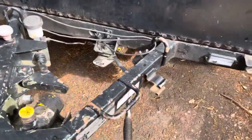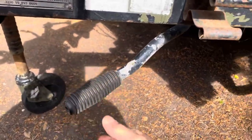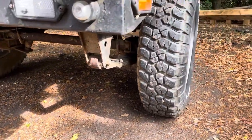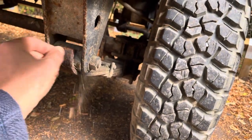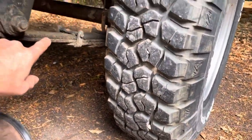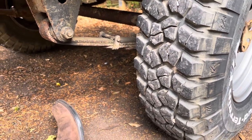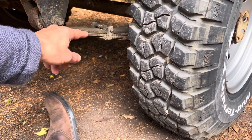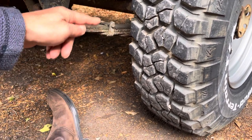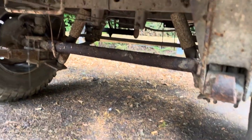Another thing I've noticed is the handbrake doesn't work either, so this trailer needs a full refurb really — everything on the trailer's a bit battered. But I didn't need a new trailer because they're so heavily built — this is 3mm steel, that's been around 30 years, it's not going to go anywhere. With the leaf springs, what we're going to do is rope them. They used to do that on old-fashioned cars because the springs are exposed and they rot out. So I'm going to take these apart, get them blasted, put them back together again, and then rope them. You soak the rope in oil and then wrap it in a spiral around the springs all the way across, and they just last forever.